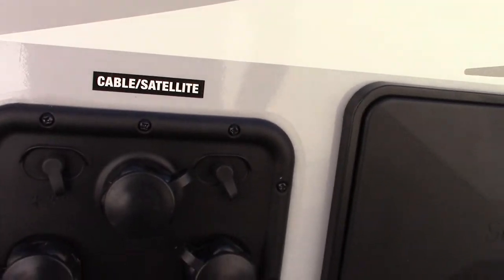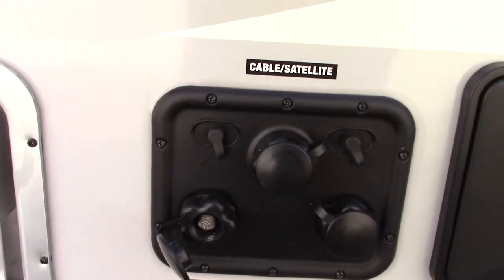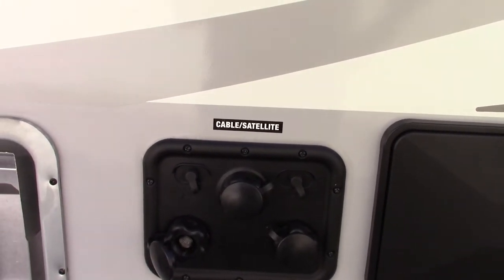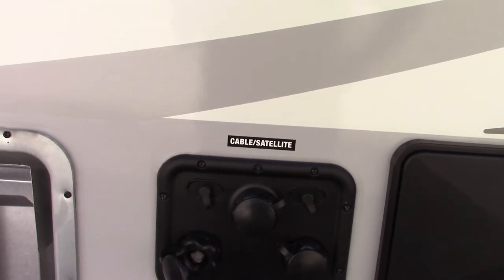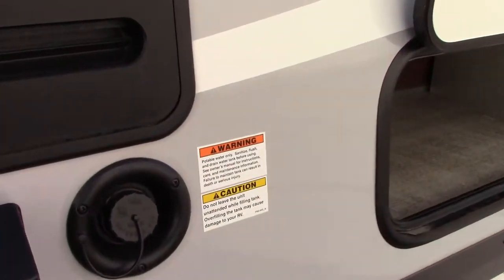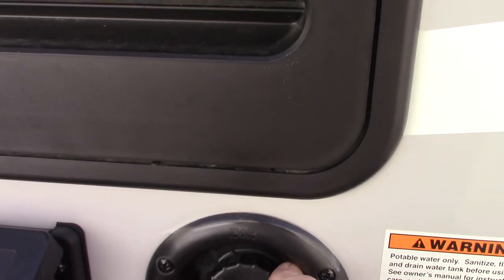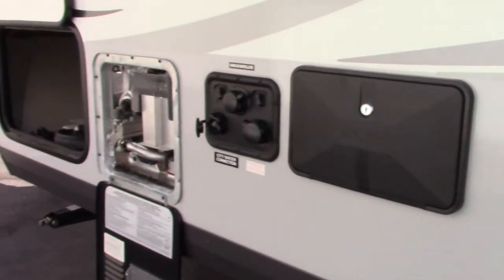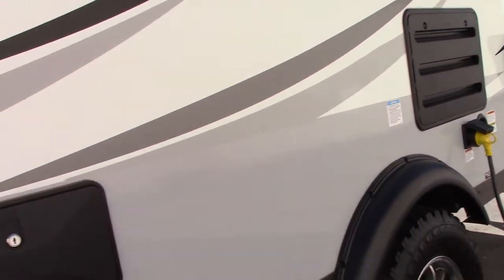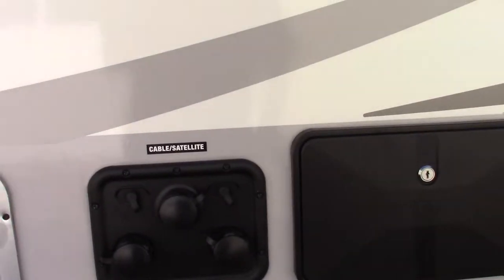Here are your water hookups. City water is the most common way to get water to this trailer — you basically just put your hose on here, turn it on, and it's ready to go. If you go to a campground without plumbing on the campsites, you can pre-fill your onboard water tank right here before you arrive, then use the onboard pump to pump the water. They're independent of each other — city water handles everything on its own, and the onboard tank and pump work independently as well.